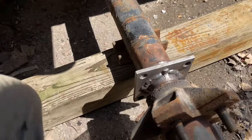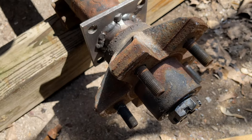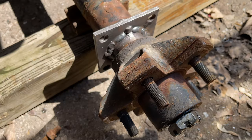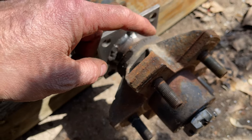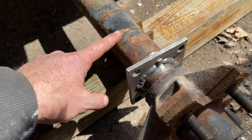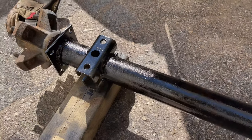I got the axle down — I ended up cutting the U-bolts that hold the perch onto the springs. I'm not a professional welder but it'll be solid; I welded both sides of the plate and put some anti-splatter nozzle dip around where the seal and bearing go. I'll measure the distance between the existing perch and the new one to make sure they're the same on both sides, then weld it on.